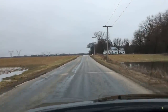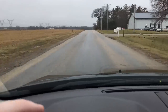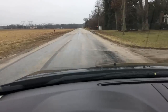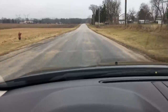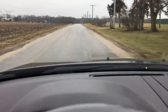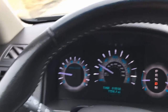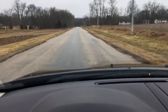Beautiful, gray, murky day. We'll test these brakes out, get some speed going — about 50 miles an hour. You can really feel it in the left front there. I'm not getting too much in the steering wheel. When you have warped front rotors or rotor thickness variations, you don't always get the vibration in the steering wheel where it oscillates back and forth. It's just thumping up there on the left-hand side. It feels more like a rotor thickness variation on the left front. Let's get back to the shop and check it out.